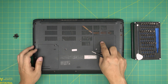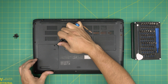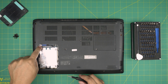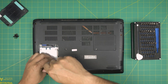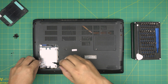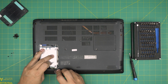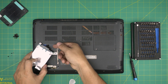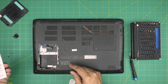We're not going to touch the small cover — we remove its screw but leave the cover. For this big cover, stick the screwdriver right in here and lift it firmly upward — you're not going to break it. There's a hard drive here we need to remove. Remove the four tiny screws for the caddy. Once done, grab the back end of the hard drive, lift it about 10 degrees, slide it slowly to the side, grab the adapter, and pull it backward gently so you don't stress the flex cable.